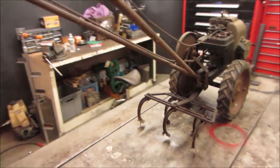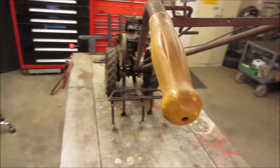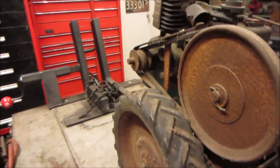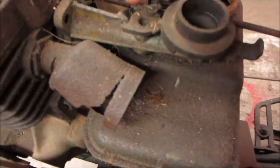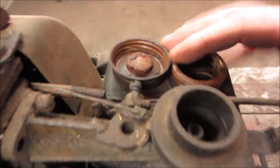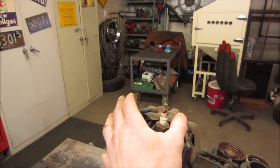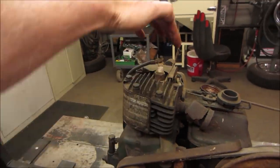All right, let's go pop you in a stand. Old looking grips are pretty cool, huh? Be even good for a bike project if it's too far gone. Exhaust is rotted out on it. Throttle moves. What's the choke? Missing the air cleaner. That's the kill right there. Not set up right. I guess you gotta put your tongue across it to short it out. Or somebody put a taller plug in. They had a lower plug in at one time.